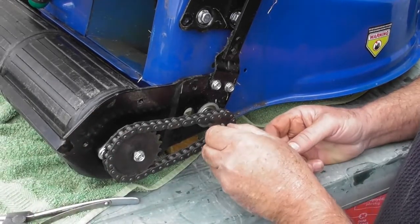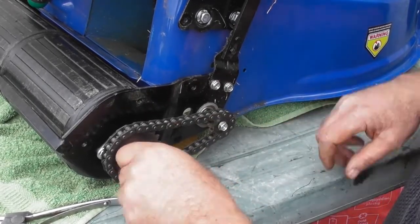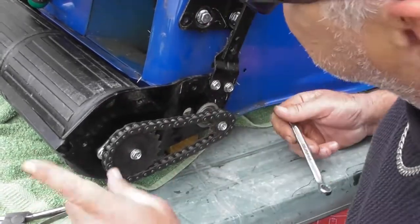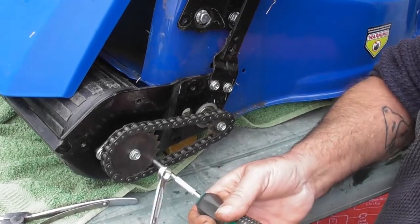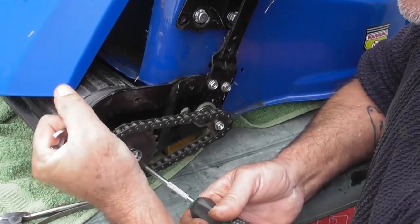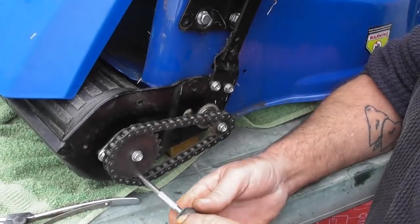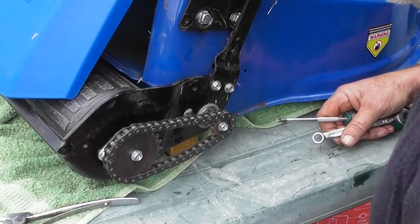And we can put a little bit of oil on this chain before we cover it all back up. So just nip that one first, get this one nipped. Okay, so we need to use the same principle now to lock the chain. I'll put a screwdriver in there, in one of the teeth of the sprocket, hard in. As I go to tighten the nut, it'll lock off against the chain there and stop it spinning. That's that one tight. I can leave it there, tighten that one, and I can just pull my screwdriver out, and that's the two sprockets replaced.